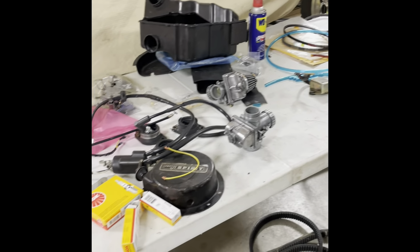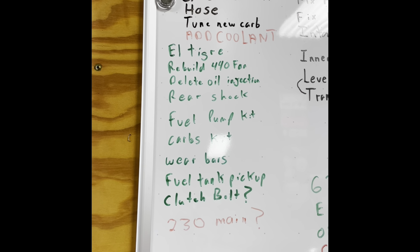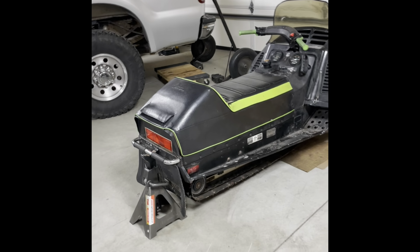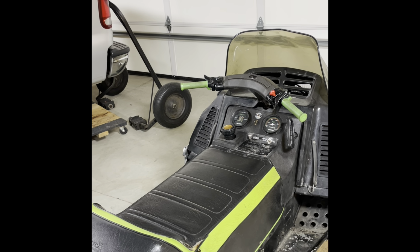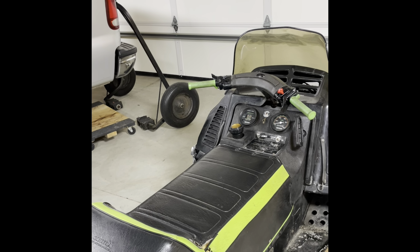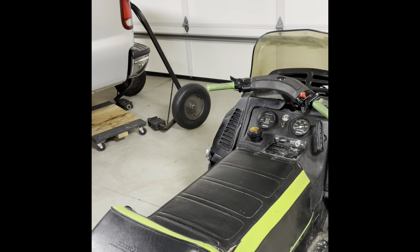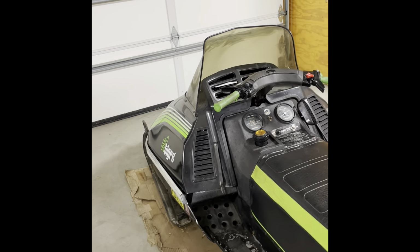There's some stuff I'm gonna leave out here, like the pilots and the mains, and I'm gonna update that board of what I'm working on, or what's left. Yeah, dial the carb, swap the fuel shutoff and the fuel filter around. Those are in backwards. I want the other way around: the filter right after the tank, shutoff valve after the pump. I got them reversed. Just kind of how it went when I had that temp tank installed.